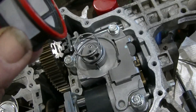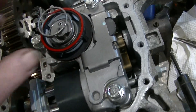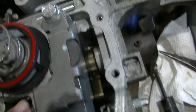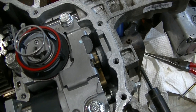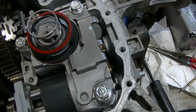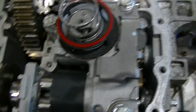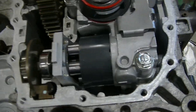I cleaned the filter — there was a wee bit of stuff on it, but it really wasn't bad for filth. There are two magnets buried under this cover here, accessible by removing this bolt. I was able to take those magnets out and clean them. There was a little bit on there — not really cuttings, more or less a metal powder.